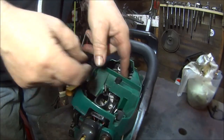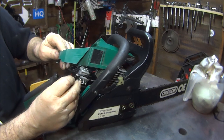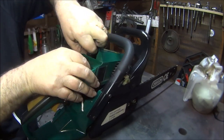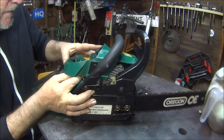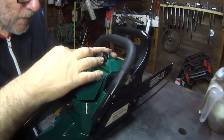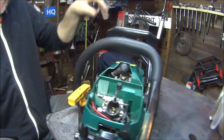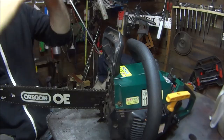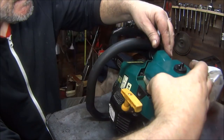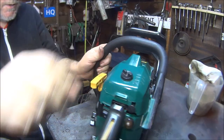Need the choke up there. Need the HT wire through there. It's a bit fiddly with this choke. Get the HT lead. Bloody fiddly thing. Whack a screw in this side, whack a screw in the other side, that one at the back, do the one at the front. Slop that down there, put the filter back on. Slop that down there and that's it.